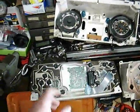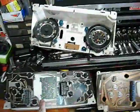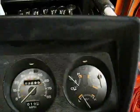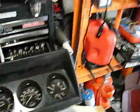You pretty much just have to cut and tap your wires. If you ever pull a cluster out of the yard, make sure you take the connectors with you with as much wire as you can — that way it makes it a lot easier on yourself. Obviously the cable-driven goes here, and then you can remove the cable from the vehicle completely. As you can see, the 1990 cluster has a kind of cleaner, more modern look, while the older one has a very eighties look, and this one has a much smoother finish.